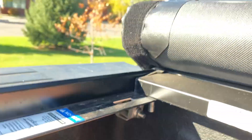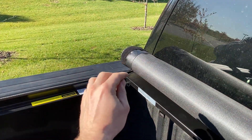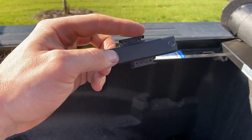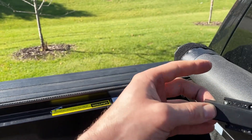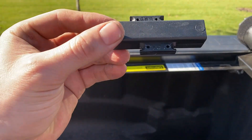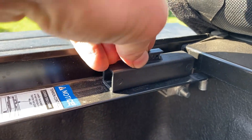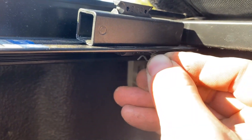We have the studs down through the holes. Before tightening anything, we need to put in the adjustment bricks. If you got this tonneau cover, you'll get two of them — one for each side — and they'll have numbers on them. They're offset, so depending on which way you rotate or flip them it gives a different tautness to the tonneau cover. The way that worked best for me — though it could be different for everyone — was number one facing down and toward the front of the truck. Put it down into the slot all the way, then slip the provided R-key through the hole.